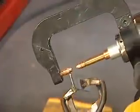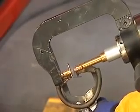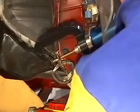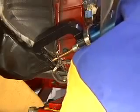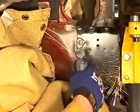Practice welds are made with a squeeze-type resistance spot welder in preparation for welding on the vehicle. A shunt clamp is placed on the vehicle close to where the first spot weld will be made, and the frame rail is spot welded to the rocker panel. Before installing additional parts that may hinder access, the GMA MIG plug welds are dressed.